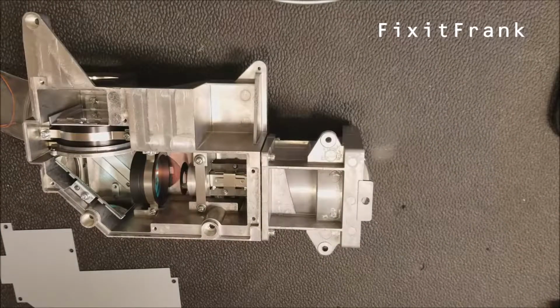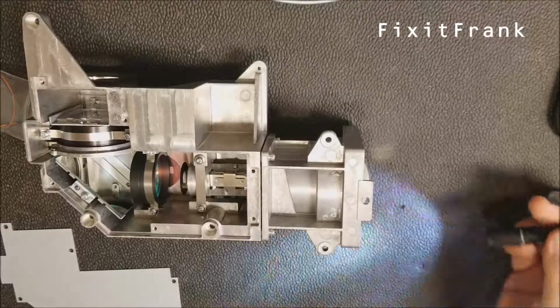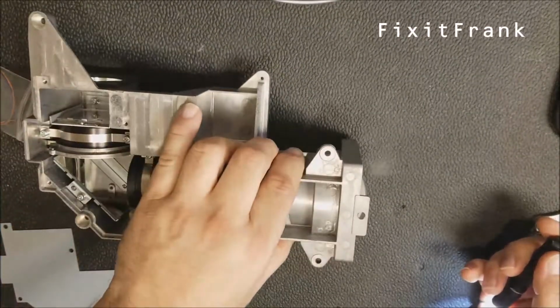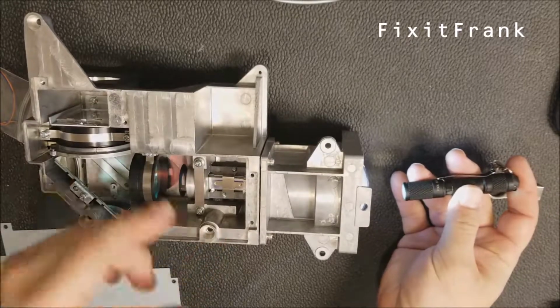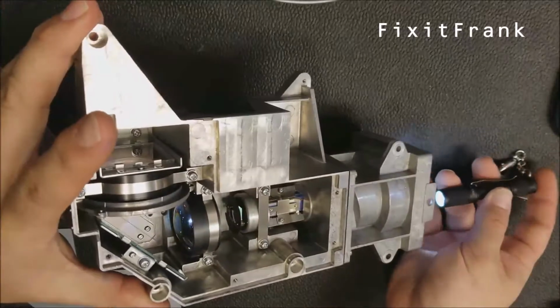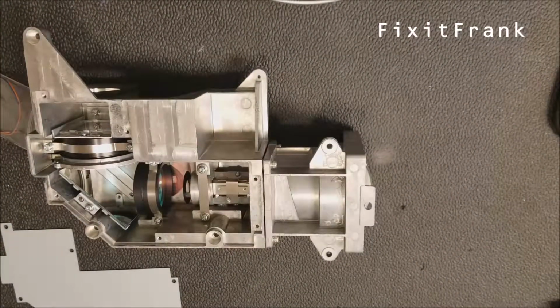integrator tunnel is what takes the lamp, which I will simulate using this fancy flashlight, shines in through that lens right there. Once it goes through that lens, the integrator kind of combines it all together. It's a square piece of glass. Oh, actually I have one. I guess technically it's a square mirror.